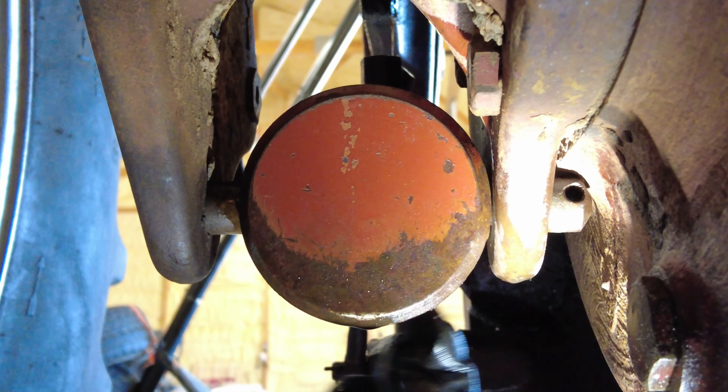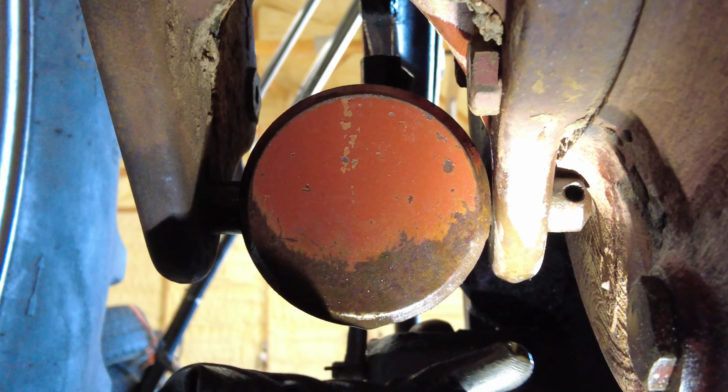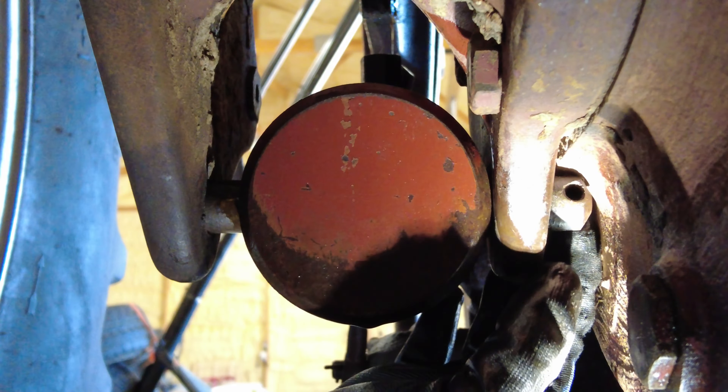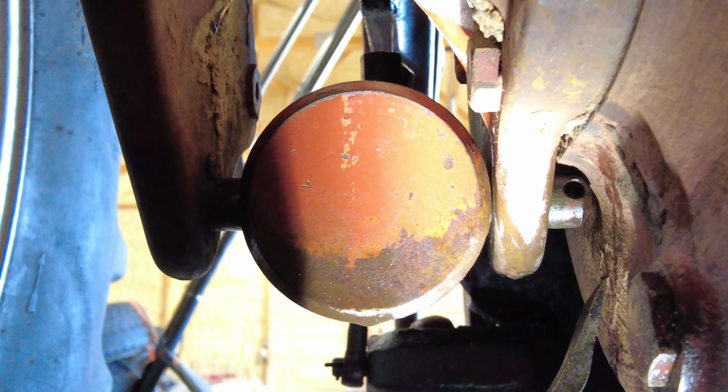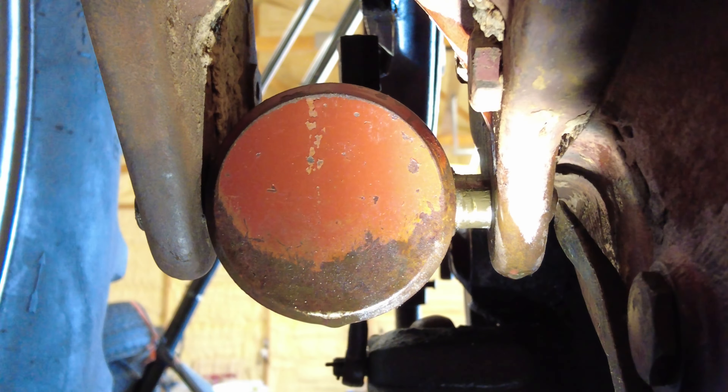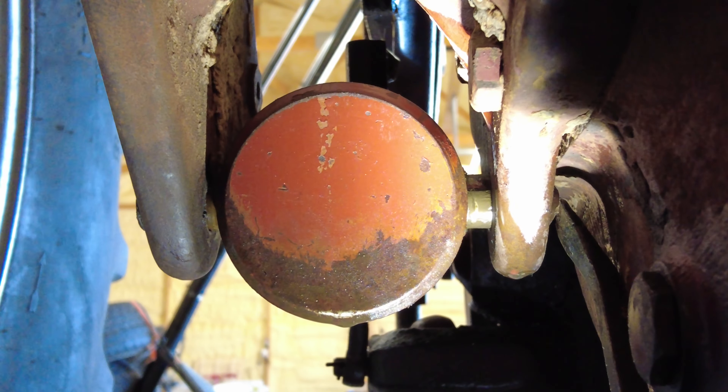Alright, so right here — this is the side we need to push this pin towards, it's got to go towards the wheel. Same thing on the other side — no matter what it's going to have to go towards the wheel. This pin that was right here makes it so it can't go out that way, and it can't go the other way either because it's going to hit the dip. I took this pry bar, got it up there and got between here and started pushing.